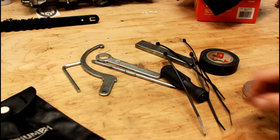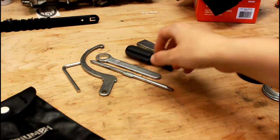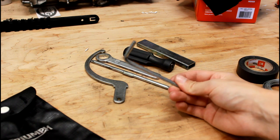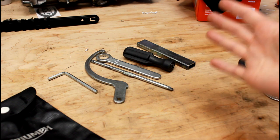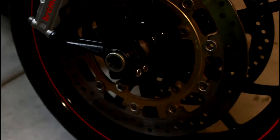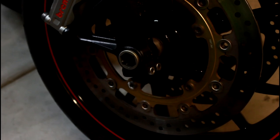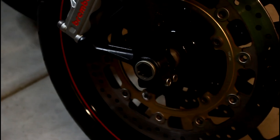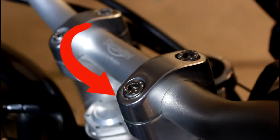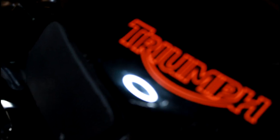Honestly, this kit that came with the Triumph is either missing things or it is really just this sad. I think this is a five millimeter allen key and it really doesn't fit anything other than a couple of the radiator guards. So let's talk about the tools you'd want to have for a long trip or at least for an emergency. I always check these things before I go on a ride, but just in case I always make sure I have them: the front axle pinch bolts, the axle nut itself, the brake caliper allen keys, the handlebar clamp bar allen keys, and anything necessary to take off a gas tank — sometimes there are things underneath your gas tank that you need just a little bit more space to see, and being able to pull that off is super helpful.